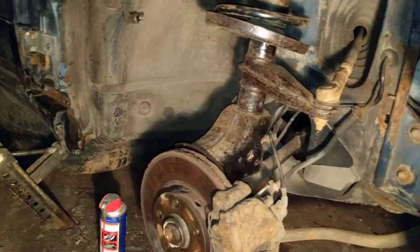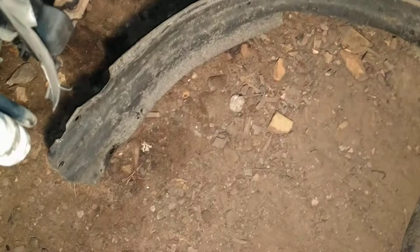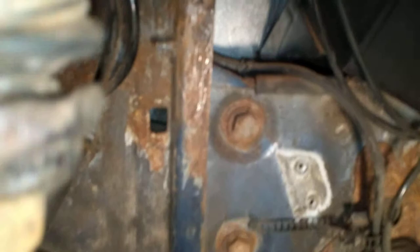The procedure is: you first have to remove the wheel. Once you've done that, you have access to a bunch of Phillips screws inside the wheel arch that hold the plastic splash protection shield — the splash shield or underwing, whatever it's called. It's secured by a bunch of Phillips screws and two interesting rubber hex nuts.